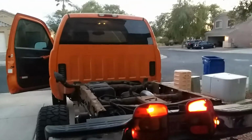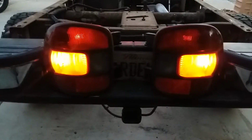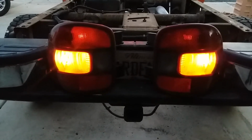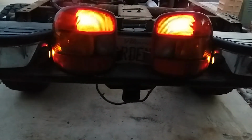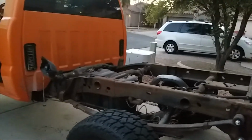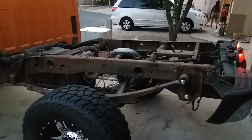Also, turn the signal off. Go to the rear here. Got tail lamps on. Hit the brakes. Center high mount brake lamp works, but the turn signal lamps light up on the braking circuit. These are also lit as part of the tail lamps. They went dim, but the turn signal lamps are bright. Okay, brake off. Everything goes back to normal. So it appears that when the headlamps are off, everything works fine. When they're on, everything goes wonky. Brakes and turn signals.